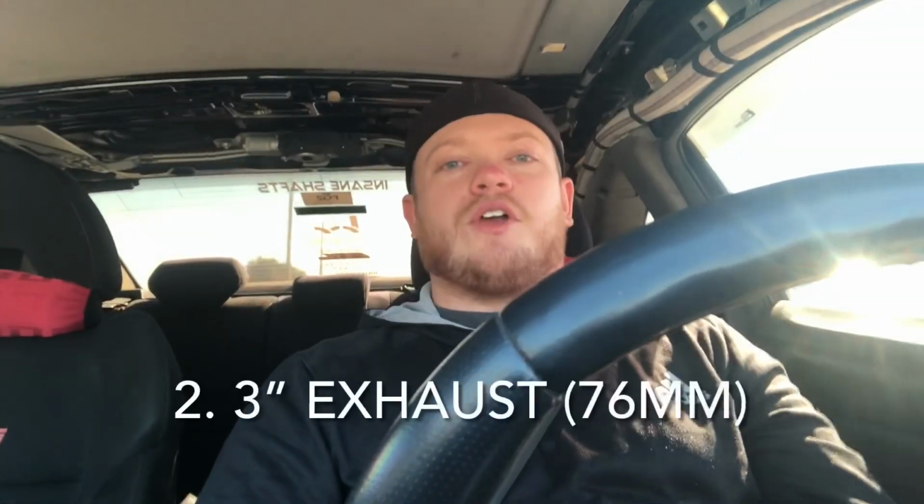So as soon as anyone gets a new car, they want to start messing with the exhaust, of course. So I'm going to make that my second mod. I would definitely recommend starting off with just saving up for a 3-inch exhaust. They don't make the K-Tuned exhaust anymore, which is what I have. But right now, there's a couple good options. You have the Fullrace 3-inch exhaust, which has been proven. That's a nice quiet exhaust. There's actually a replica of that that sounds pretty much identical to it. Same design and everything. Hooks up with V-bands. It's super nice. That's the Rev9 exhaust. So it's about half the price of the Fullrace. I would definitely recommend going that route.